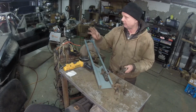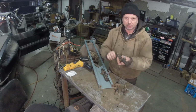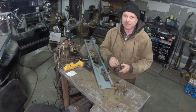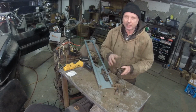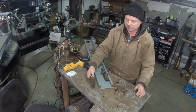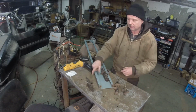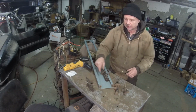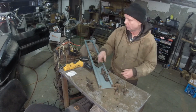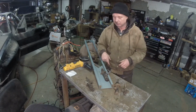And if I can get the firewall set up so I can just bolt it in and not do any adjustment, just put the clutch pedal in and just go, I have a feeling that might be the actual way to go on this build, and you can get it in and out and it'd be so much simpler. So let's first start cutting this thing up, and I'm going to start measuring it and fitting the clutch master cylinder to it. Then we'll figure out how much we need to put a hole in it for the wiring harness. So let me get my goggles and stuff on, and we'll just start blasting this thing out.